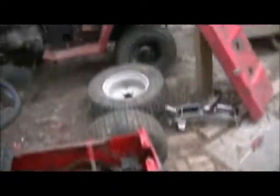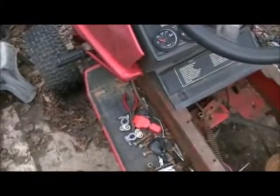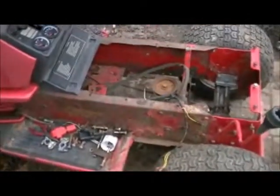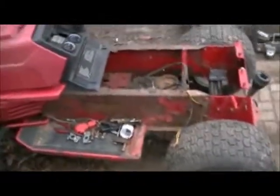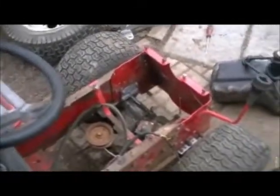Other than that, the gas tank fits — I've tried that. The rear cowling will fit, nothing's changed there. The middle piece I'd like to use, I don't know if it will fit yet because I don't have a shifter in yet. The next step really is to put the shifter in and the shifter support, because this one uses a shifter support unlike the other one which basically went straight down to the transaxle. Anyway, that's pretty much it — keep it redneck like always, subscribe, comment, and have a great day.